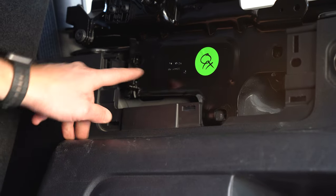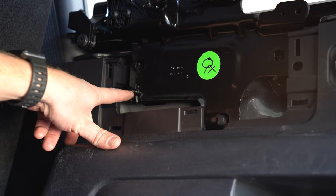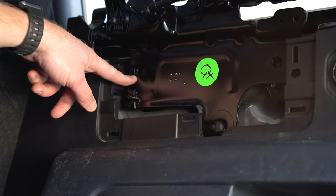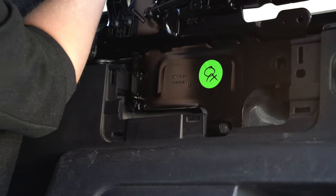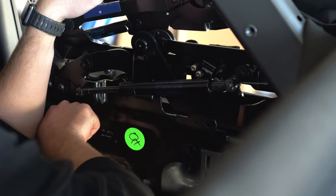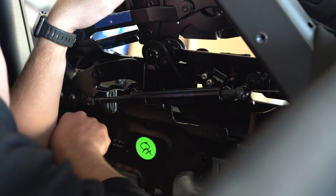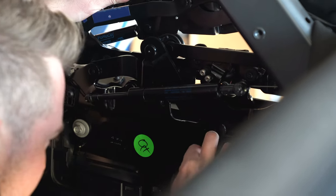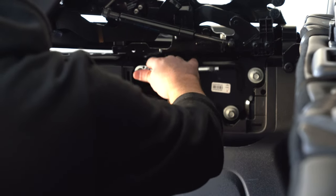When you're setting this in here, you want to make sure that this little notch fits over this peg, and then the hole for the bolt — you're going to have to push down so you can see it and get it in that hole, as it wants to buck up a little bit. Which is fitting, I guess, for a Bronco. Then I'm going to take the 13mm ratchet and get these bolts a little tighter.